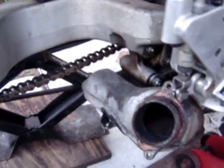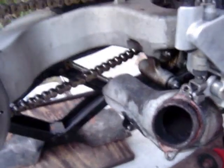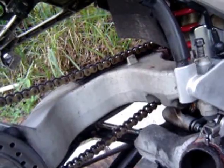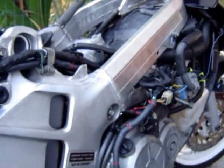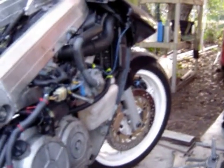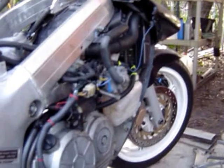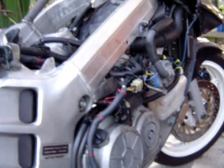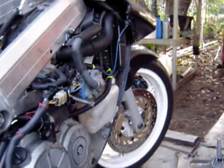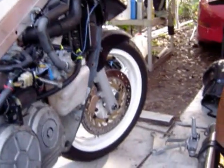Whatever the case, I have new oil lines. For the valves, I've got one set of upper cylinders off a running bike, and I don't think I can do the front. So what I'm going to do is probably remove the rear upper cylinder, drop in the new ones, and then let the shop adjust the front ones only.